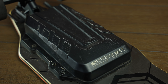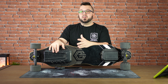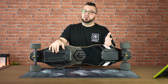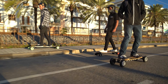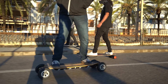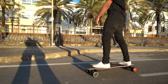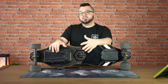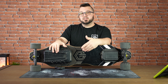This board is equipped with a battery that the industry usually calls long range. Usually a standard board comes with a 4Ah battery, but this board comes with a 7.5Ah battery, that is around 270Wh — almost double the range of a standard board. And this is important because when we talk about the price, you will understand why this board is so good. This battery has a setup of 10S3P with 18650 battery cells in it.